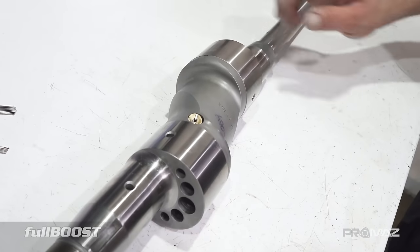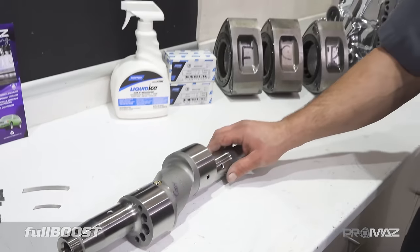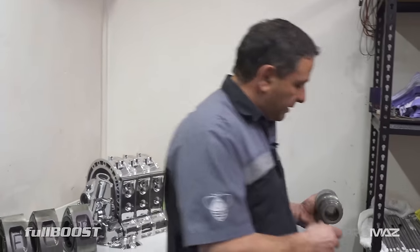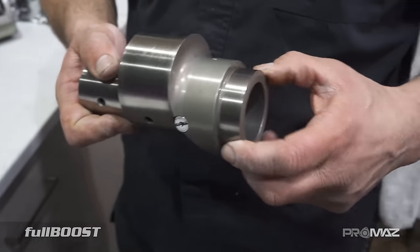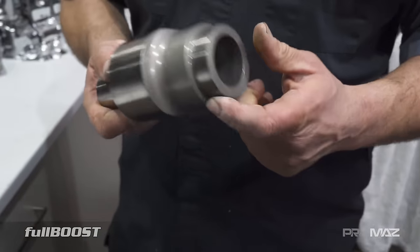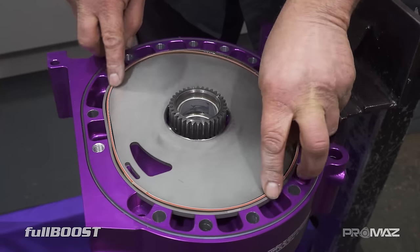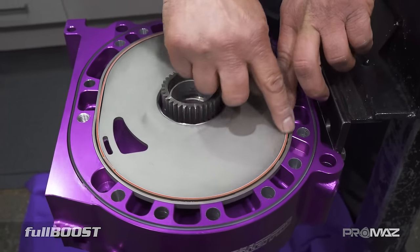This crank is a nice bit of gear. It's an aftermarket replica of the factory crank, with Billet Pro's added bearing support for the centre plate. It has a special sleeve as part of the crank where the roller bearing runs — it helps support the nose of the crank. 20Bs suffer a lot from that. We've found it to be really good and reliable. We use factory O-rings, the most reliable — always put the join at the inlet port.